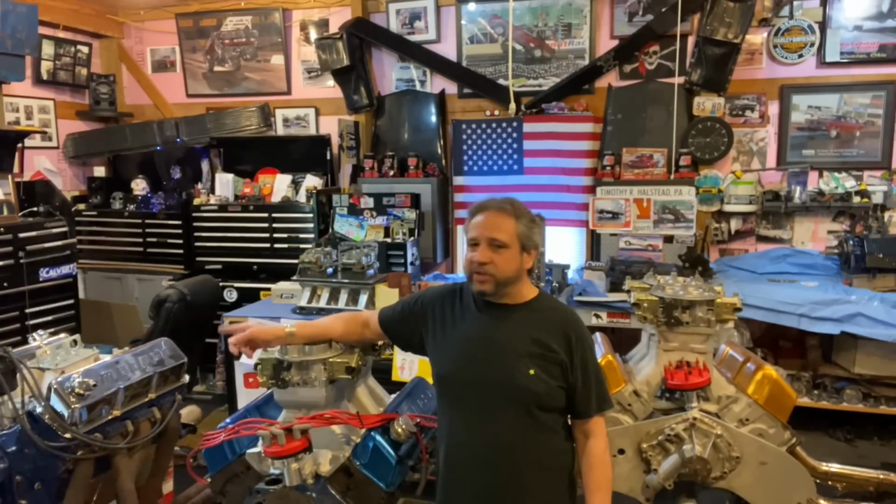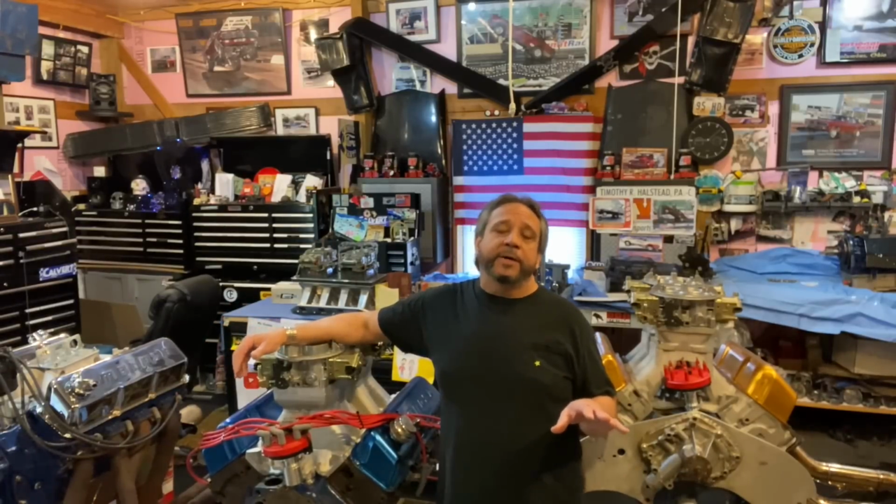For a pro stock motor or something in the upper end, you're not going to run a hydraulic roller or a solid lifter. Those are good for street cams. We'll talk about that as we get into maybe talking about this 354 Cleveland. We'll go into some street cam specs because a lot of guys are into that scene. They're not all running 800 horsepower Clevelands or trying to get one. They're happy with 500 horsepower, and on the street, that's pretty nasty. Even 450 is pretty nasty on the street.